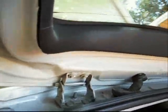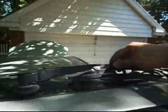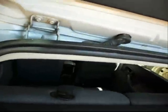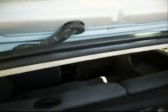You can see, maybe you can't see, there's some wires. The wires go up in through here and down and back to the bottom of the hatch for the wiper. And these plate lights, they also go to the third brake light. And they carry just enough power and just the right way that they can really mess up your ECM and all that if they're arcing with each other.